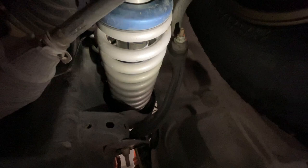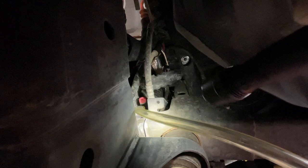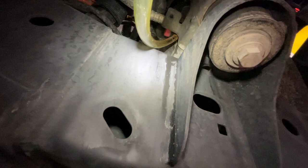I'm on the passenger side of the truck, outside of the frame rail. The radiator drain valve or petcock is right there — the red one. I took a big piece of half-inch OD, three-eighths inch ID tubing and stuck it over the nipple. It looks like it takes a flat blade screwdriver or you might be able to turn it with your fingers. Going to pop that loose and let the coolant drain into a five-gallon bucket. You can also see where an upper radiator hose leak would run — mine ran all down the frame rail here, still wet from the pressure test.